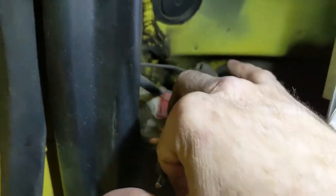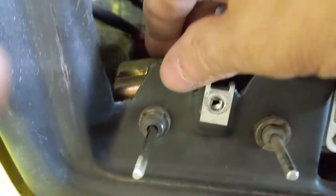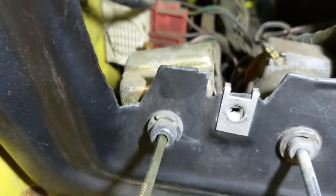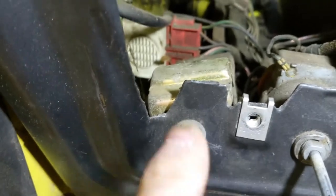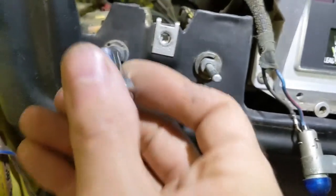I don't think you can do it with one hand — it's a bit of a struggle. But that's it: push that button in and pull the shaft out. That's the procedure for getting the headlight knob off. The knob grips on there, but someone has already broken the seal on it. Shove them back on when done.